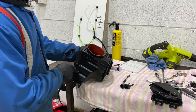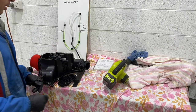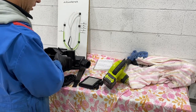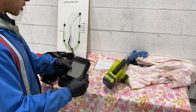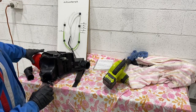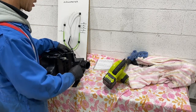What I also used to put this hole through here was this little collar, and this actually goes in as reinforcing for when we put our outside air filter on. Okay, now we have the full setup of the air filter. It consists of the UniFilter intake. Also have the Hurricane stainless steel air filter. So this is what we're going to test now, and I'm hoping this will flow a lot better than the last one. So that's all UniFilter. The actual Hurricane stainless air filter, modified internals with the CB300 intake boot. So let's see what this does.